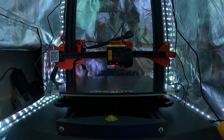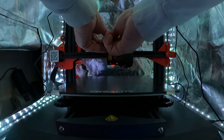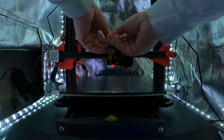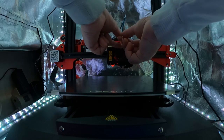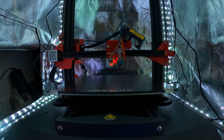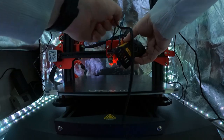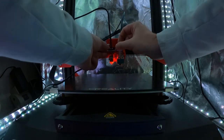I'm going to be using my Creality CR-10S Pro V2 for this video. The USB stick for the Sonic Pad has some parts you can print to mount the accelerometer directly to the printer. In the case of the CR-10S series I don't believe there are any printed mount parts available, so we're going to do it a little differently. First, remove the hot-end cover from the printer. Then take a piece of double-sided tape and put the accelerometer on top of the BL Touch. Once done, put the hot-end cover back into place and screw it back in.